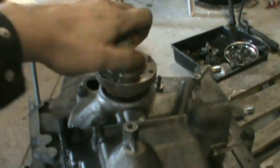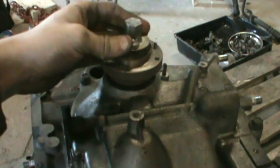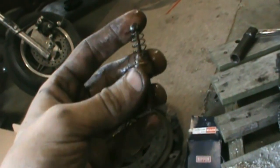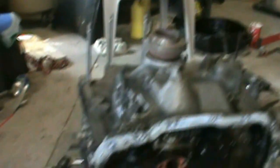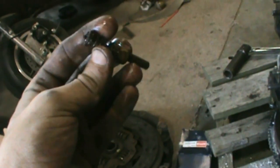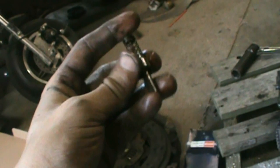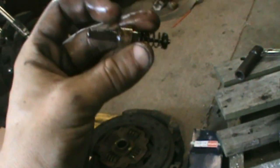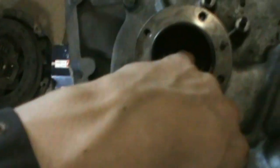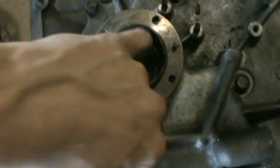You can see in here there should be the thermal pellet — it's got a big bolt and a little copper washer in there you have to replace after. This is the thermal pellet — it's basically like a little thermostat for the engine oil. It won't start putting oil through the oil feed on the eccentric shaft until it hits a certain temperature. That's why at idle you'd see the oil pressure really low. But there's a modified part — just a machined piece of aluminum that shape — so you get full oil pressure all the time. Just stick your finger down in the eccentric shaft, use your pinky to hook on the spring. There we go, that stuff's all out.